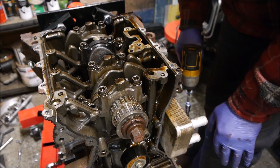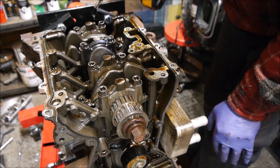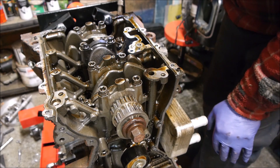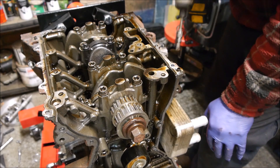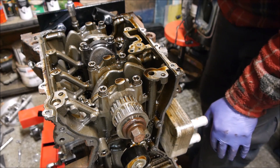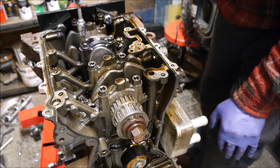So we're getting deep into the bowels of the engine now. We've got the timing chains off. I've cracked these off and you're doing them in a sequence. I'm going to start to have a look at these main bearings. It's very important to keep them in the same orientation and the same way around. So as you take them off, lay them on the floor in the order that they're going to go back on, because they are line bored through, machined through.